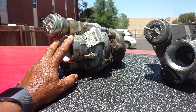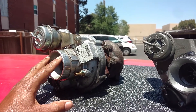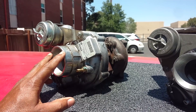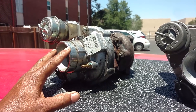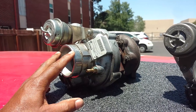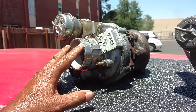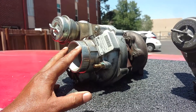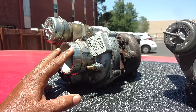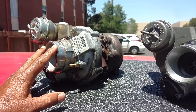If you have a 15-year-old turbo in your car with 150,000 or 200,000 miles on it, that turbo is probably wearing. One of the first signs you'll get in a wearing turbo is it takes longer to spool up and it won't deliver the power it used to when it was new. The worst symptoms are smoking under acceleration, the turbo getting noisy, and eventually it'll wear out so bad that it will hardly boost at all.